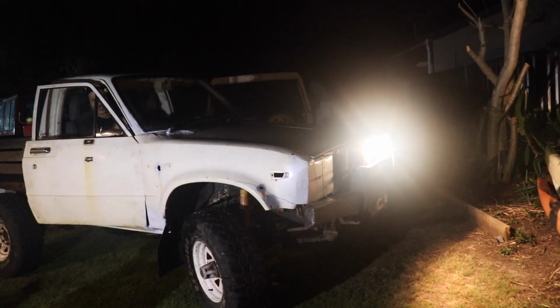After some high-tech diagnostic wire jiggling, we soon found that the wires that were connecting the distributor to the ignition module on top of the coil were no longer connected. So with some professional joining, we were soon back on the road.